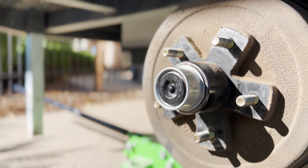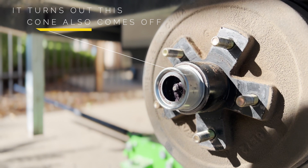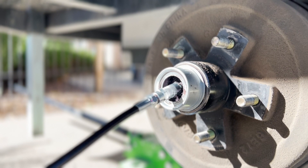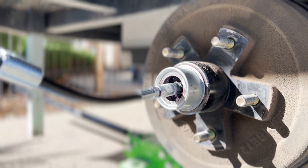Removing the wheel on my trailer exposes a soft rubber gasket that protects the grease pack. You can use tools to take it out, but usually your fingers are all that's needed. Take the nozzle of your grease gun and gently press it onto the grease zerk — you should feel a soft click. Press the trigger of the grease gun to begin pumping clean grease into the wheel.